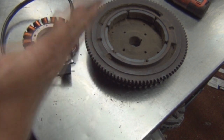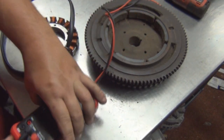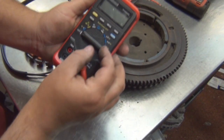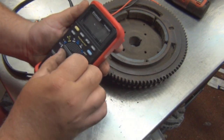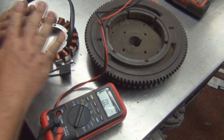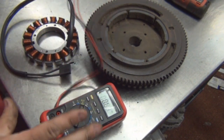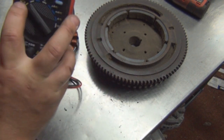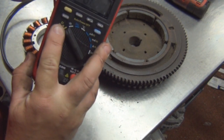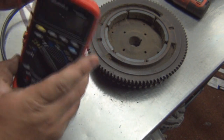The direct current will go right to your battery and keep it charged while you're mowing. Now let me show you what a good stator looks like so you know what to test for. You take your voltmeter and put it on ohms. Now this is all disconnected — you do not have any voltage going to it at all. Whenever you have it on ohms, you do not hook it to any voltage whatsoever, or you will destroy your multimeter.